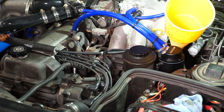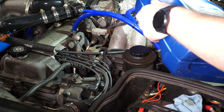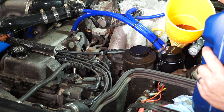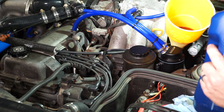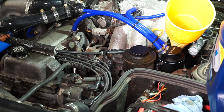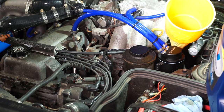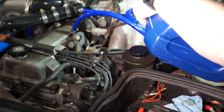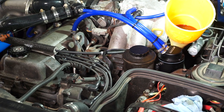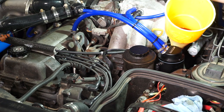Normally you'd be using DEX3. I'm playing with a different transmission fluid on mine, so don't follow my jug. For the initial fill, I'm going to start with a gallon. You've got to feed this in pretty slow, because otherwise it'll spill out from the dipstick tube — and you'll likely get some dribbling out anyway even if you go slow. I like to put a little in, then look underneath to make sure nothing's going on the ground, because I have forgotten to put the drain plug back in before and started filling it up — and then you hear the trans fluid raining down. You'll fill it up like this a couple of go-rounds until you get a gallon in it.